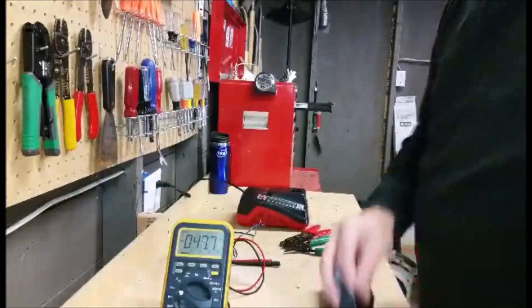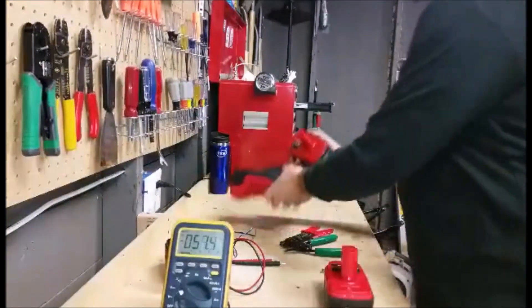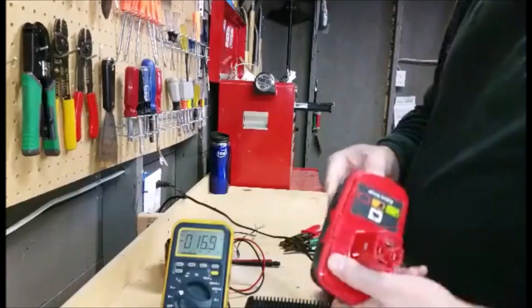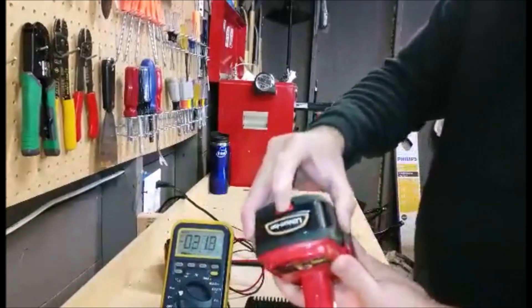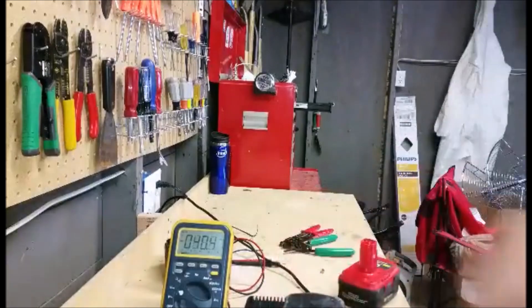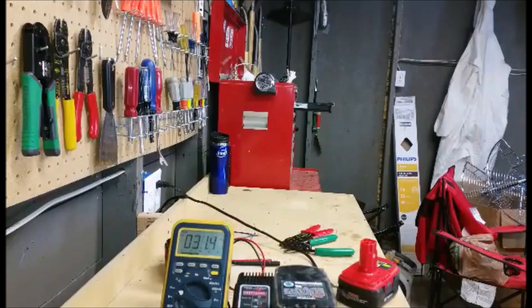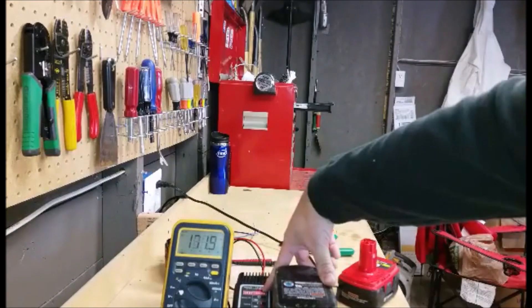These lithium-ion cells, if they get discharged too much, they won't go into the charger — it's a really defective battery. I've got my 12 volt and 19.2 volt charger, and my dead lithium-ion battery. You can tell it doesn't have anything; even when they're low, they have a green light. I'm going to put that on there and you'll see it'll go into its test mode — flashing. And now when it does the slow red, it is defective.